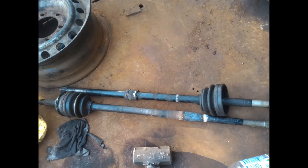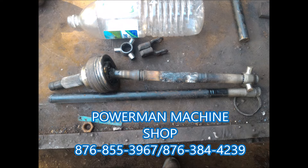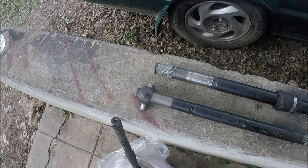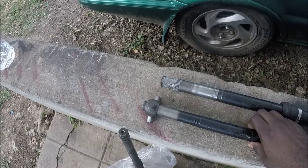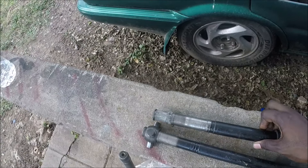On completing the welded axles, Pawman had located an axle suitable to be resplined for the long side, so we purchased that axle and had it resplined. For the short side, we used the remainder of the Honda axle — the Honda axle already has splines for the inner CV joint, so all that had to be done was to respline the area for the outer CV joint. Here is a look at the finished product — you can see the long side and this is the short side.